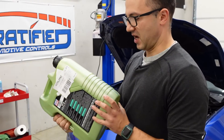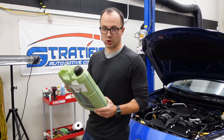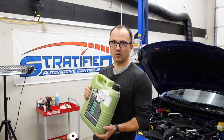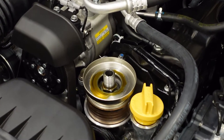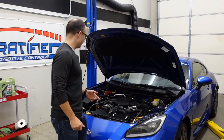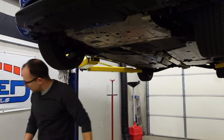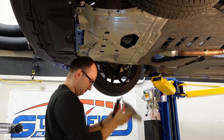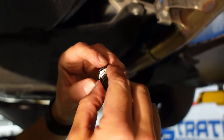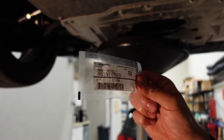This is really lightweight stuff. I wanted to keep it consistent for the sake of power — if you go thicker oil, you will rob some power. But if you track the car, you might want to consider running a little bit thicker, maybe a 0W30 or a 10W30 for high temperature protection. These modern oils are so good, however, that you might still be able to get away with the stock spec. There's a convenient little hatch here to drain the oil. Subaru has gone all European on us and provides a replacement crush washer for this.